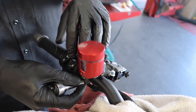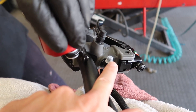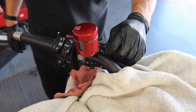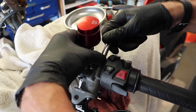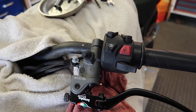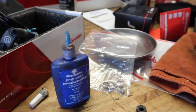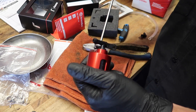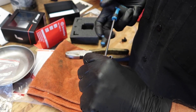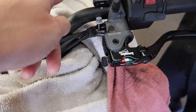So clean. We actually have to space this out because of the way it mounts, but he found a nice little spacer to put in there. We'll run the tubing from here over to here and put it coming out to the left, so you have some clear tubing right there - that'll look super, super nice. Now that he has everything mocked up where he wants it, he's going to take it all back apart and Loctite it, because otherwise he said it'll literally just come loose. He's using blue Loctite - medium strength for a medium hold - so you can actually get it undone if you have to.